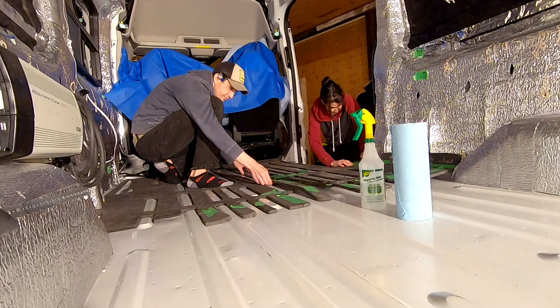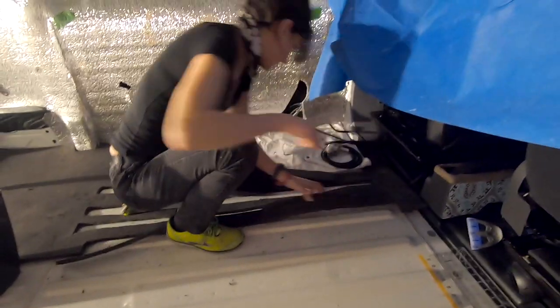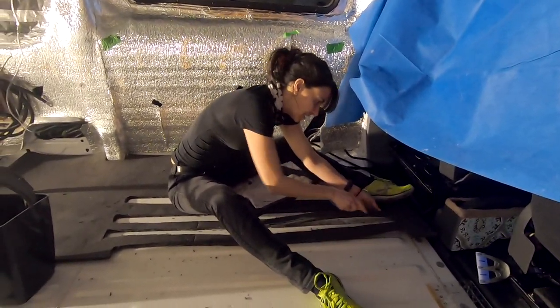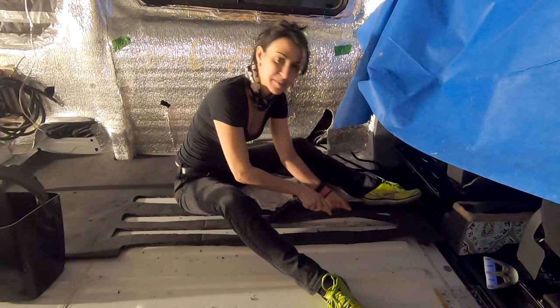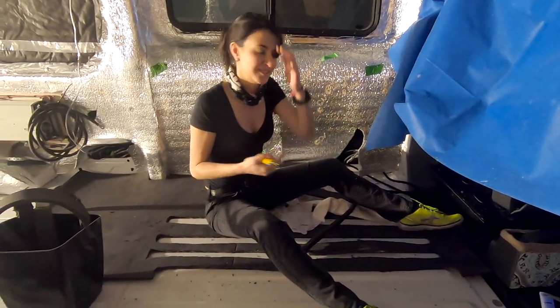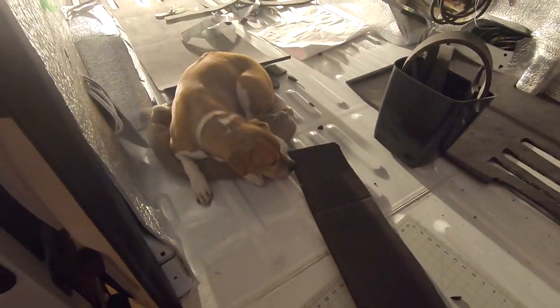In this video, we start the floors by filling the corrugations with Mini-Cell. Mini-Cell is a type of closed-cell foam known for its high structural integrity and resists most solvents, chemicals, fungi, and mold. Durable enough to withstand a large amount of pressure without major distortion, it's stronger than open-cell foam but requires more material, making it more expensive — the perfect material as a first layer of insulation.